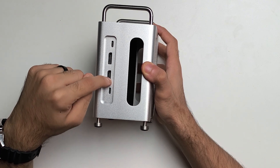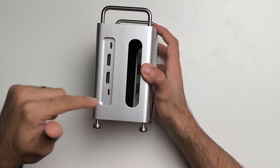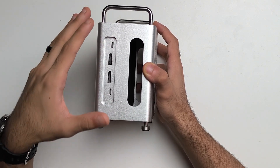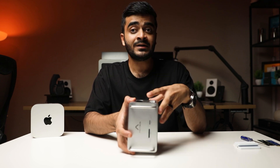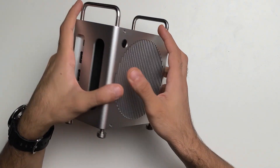You've got two DisplayPort 1.3s where you can connect external displays. And then there's a power delivery port. This dock does require external power if you want the full potential, so a 30-watt power adapter as well as a USB-C cable is provided in the box. And here is a slot for your Mac Mini's rear IO.